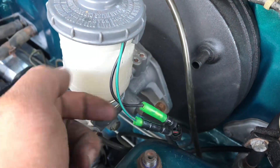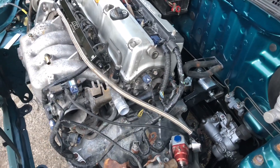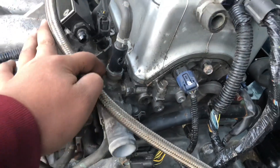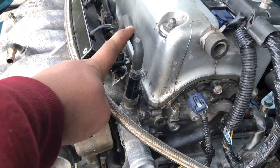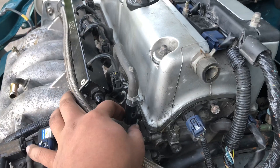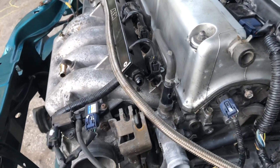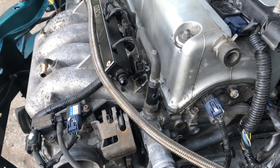Once your wires are fed through the firewall, the green-red wire simply hooks up to the green-red wire for your brake, and the yellow wire hooks up to your temp sensor — wherever you're going to put it. I don't have a temp sensor yet, but I'm going to use an air assist delete fitting — this line will be plugged and I'll have a small plug where I can install a temp sensor and hook that yellow wire onto it.